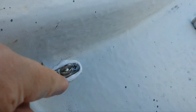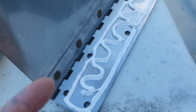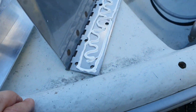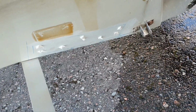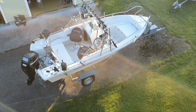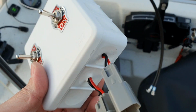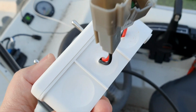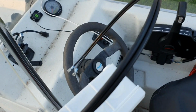Here I just sealed this place, and the new method, I put marine sealing, the same Sikaflex here, a bit of distance from the hinge, but I think it will go to the hinge anyway, and here just put sealing to the holes. That's it. Well, it's time to test it. Okay guys, I was able to close this, and even put wires there.